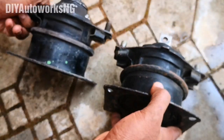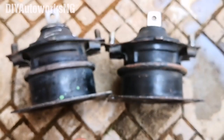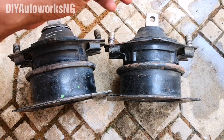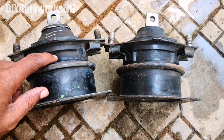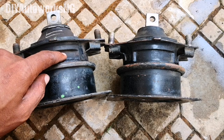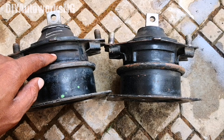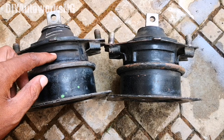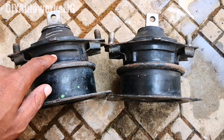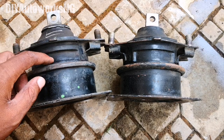Another quick test: set the mount on its side. The front of the mount faces the vehicle. You can depress this part — it goes in — and that's the anterior part of the oil chamber. Note: if you're trying to buy a used OEM, take it easy with this test. The rubber may be old and weak, and you might cause a leak, as some older parts also leak from here.